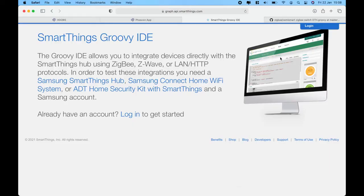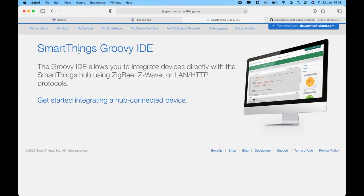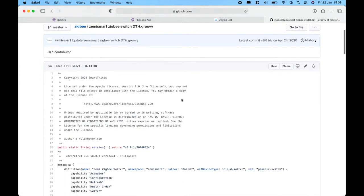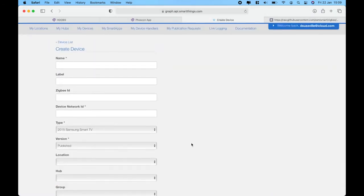For SmartThings there are a few additional steps. Go to the SmartThings login page and make sure you have an account. From my SmartThings video you can see how to add devices — it's the same process. Go to My Devices, click on New Device, and I've also added a link in the description to copy the device handler code. Copy all of that content and go to New Device. If you have the hub, you will get an additional screen where you can paste that command, save, and then do the same thing in HomeKit — restart the service and it imports the devices. Very simple — the switch is easy to integrate with your current ecosystem and expose to Apple HomeKit.